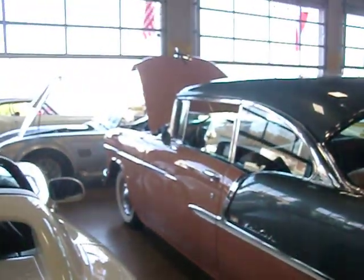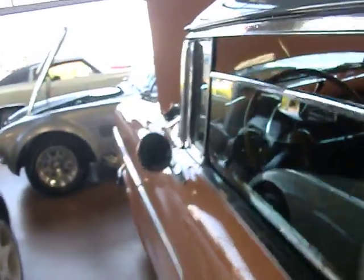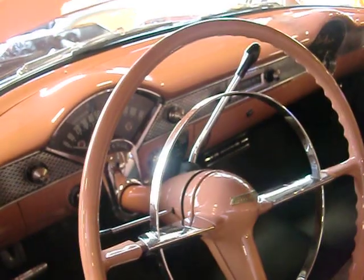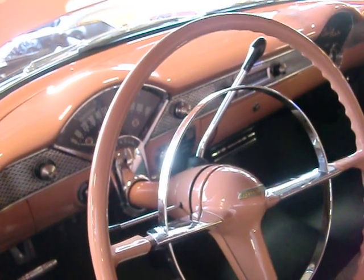What's that color called? It's got air conditioning and a three-speed automatic — a Turbo 350. It ain't original; these things came with cast iron Powerglides. You can tell it's a Turbo 350 because the pan goes up in the back slightly. And it's got some lighting underneath — light her up at the cruise night.